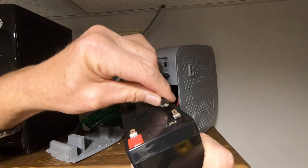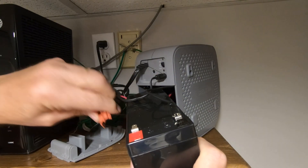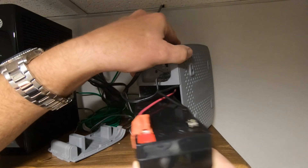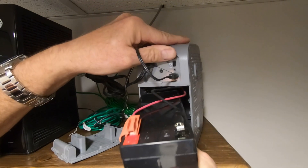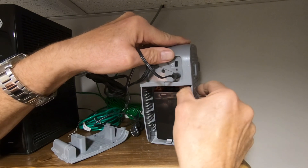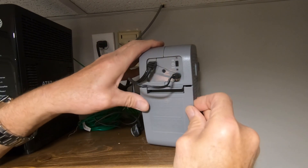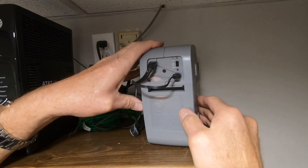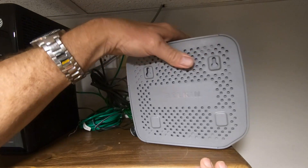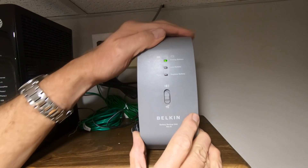So here we go. I'm going to connect the negative terminal, connect the positive terminal, slide the battery in, make sure no wires are tangled so they won't get pinched, the cover latch snaps closed, then reconnect the 120 volt power.